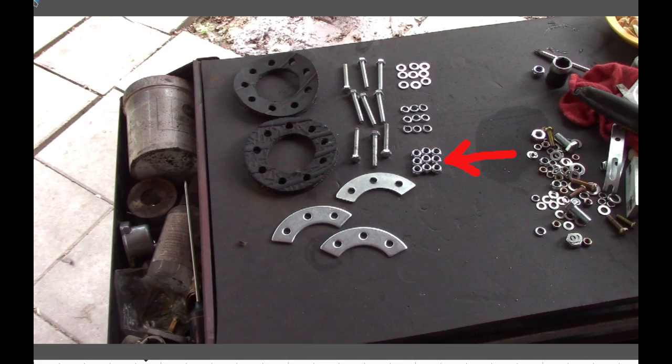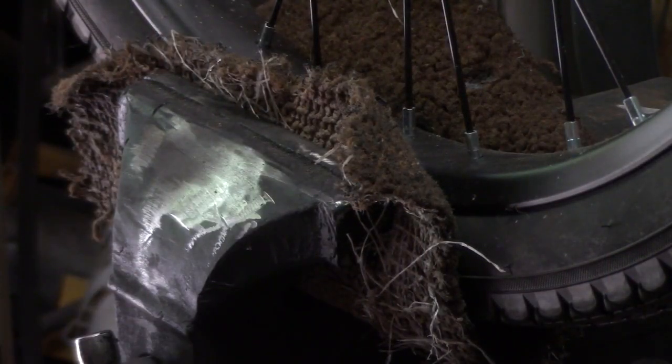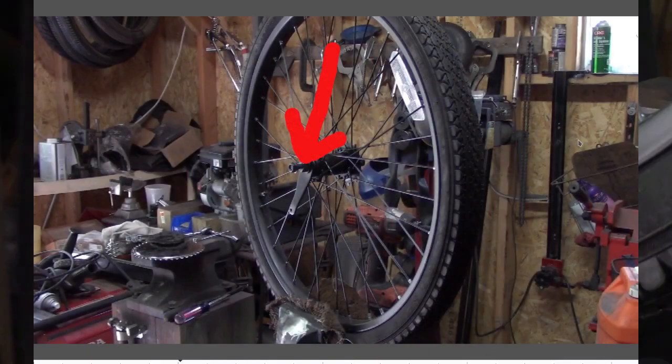The first thing you want to do is make sure the rear wheel has been trued - that you don't have any wobble in the wheel. I went over that in the previous video, so look on the playlist for the front wheel video if you missed it. I use a vice to hold my wheel with an old piece of carpet in there clamped down, so I'm not damaging the rim.